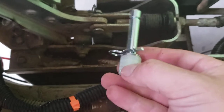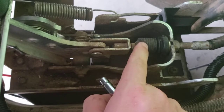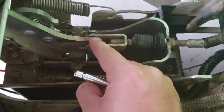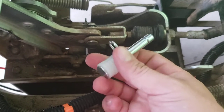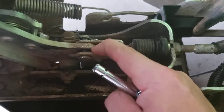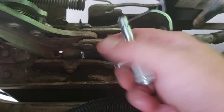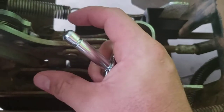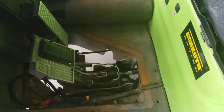This pin is going to replace the shackle pin that's pulling your brake line — you can see that from the factory there's just the shackle and the brake pedal with a cotter pin. This kit comes with two metal washers, a cotter pin, and these nylon washers. From the factory there's a gap at every position, so they give you these nylon washers to fill in that gap so it's a tighter fit and doesn't want to move side to side. I'm going to pause the video and put the pin in.